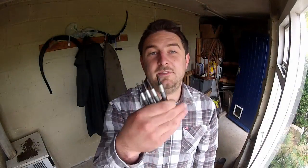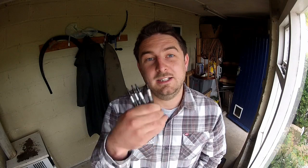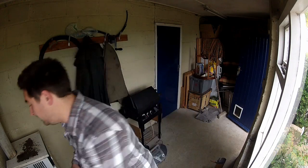Now that's the four old glow plugs removed. It is sometimes possible to do a visual check on these to identify which one or ones are faulty, and that's simply by looking at how much soot has accumulated on the tip of the glow plug. The general rule is the sootier it is, the more broken it is — but there is a much more accurate way of testing these things.